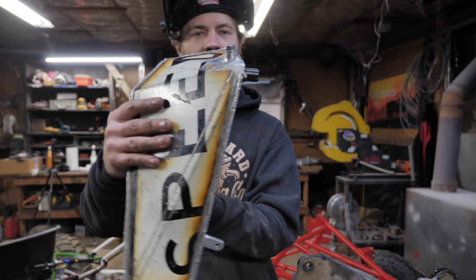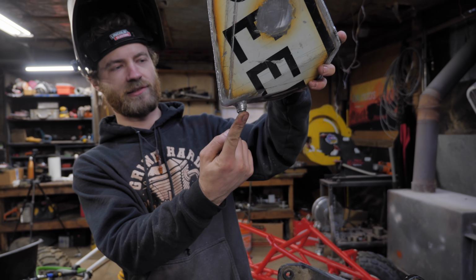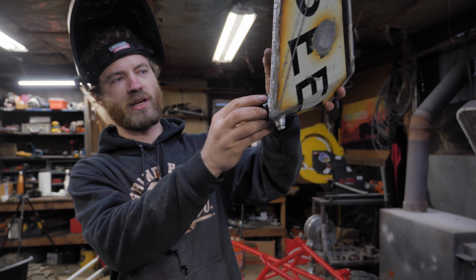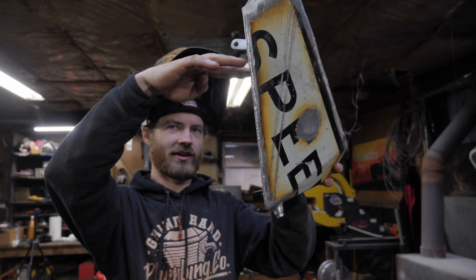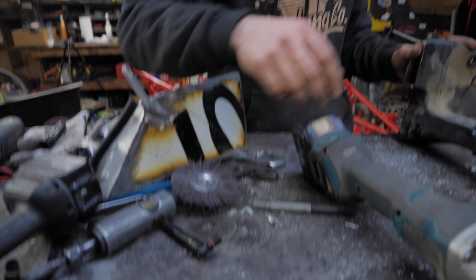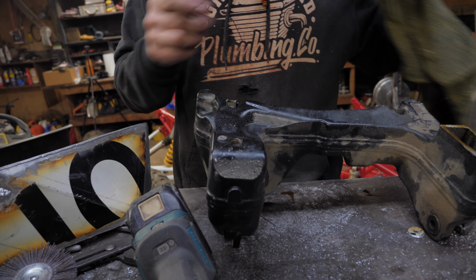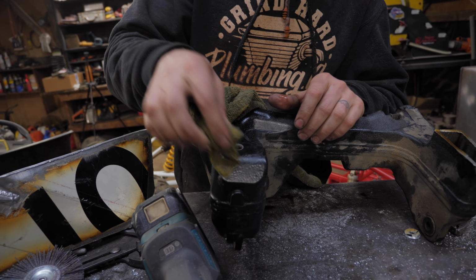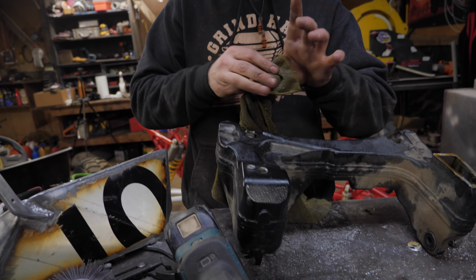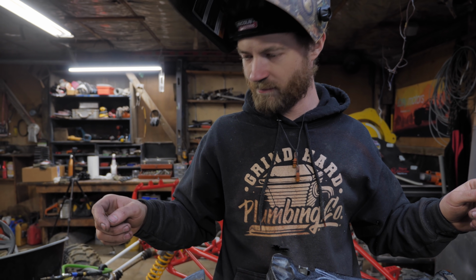And then I also decided that obviously it needed a drain plug because, you know, can't cut any corners on this one. And this is about as close to the lowest point as you could get for the pickup. But the oil level is going to be way up here, so the chances of it starving for oil are extremely slim. I have the little fitting there. I just need to cut out that chunk, which hopefully isn't supported to this ridiculous extent that the other one was. And then weld that in somewhere in here, and we'll be in oil tank business.